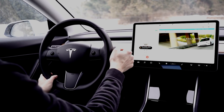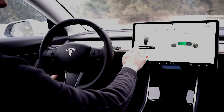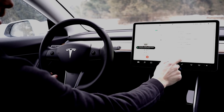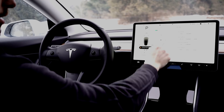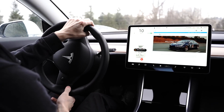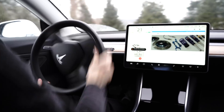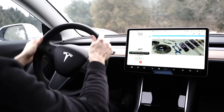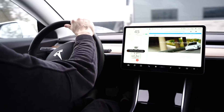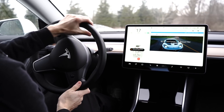So let's try it now with the party box. We go into driving, hit slip start, and with our party box installed it automatically faults the system and starts using our traction control logic. Now the party box is on and it's going to control the slip we're going to be allowed to get. Even though I'm flooring it here, it's kind of just maintaining — and that was flooring it the entire time. You can see even though it's on ice, I'm flooring it the whole time and it's just controlling and keeping that same angle.